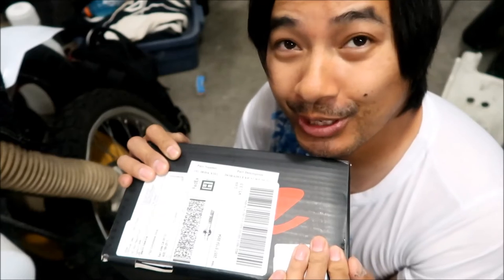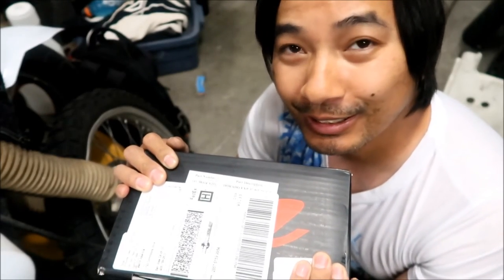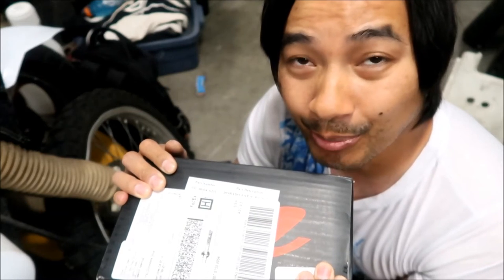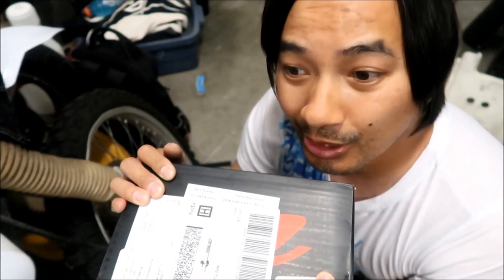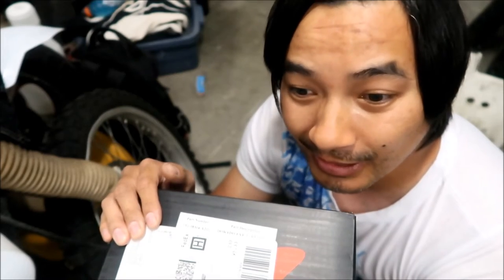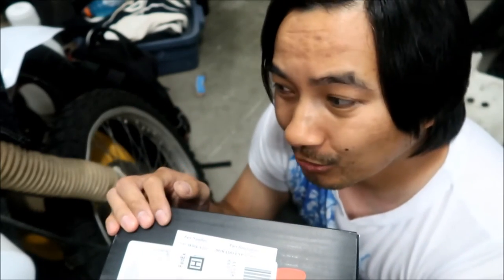Some of the reasons I want the coil fork over the air fork: Hayes Omega is old school like that. I've never used air forks at all. Air requires more maintenance — you have to make sure the air is proper all the time and it could leak, requiring a rebuild. The coil spring is less maintenance, but you have to have the proper spring in it. One drawback to the Comp is I heard it's too soft for the Suron Light Bee, because the Light Bee is a 100-plus pound bike — it wasn't designed for that. So you have to get an extra stiff spring, which I had ordered from Hayes Components.